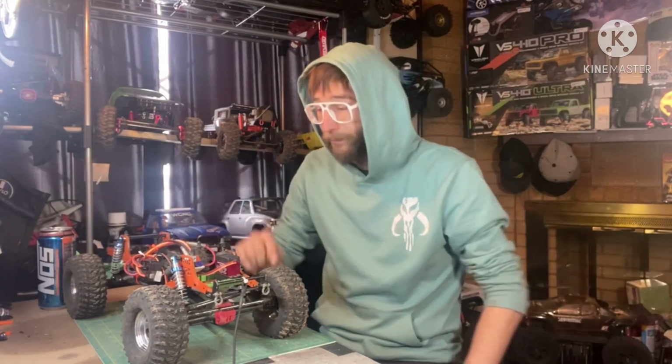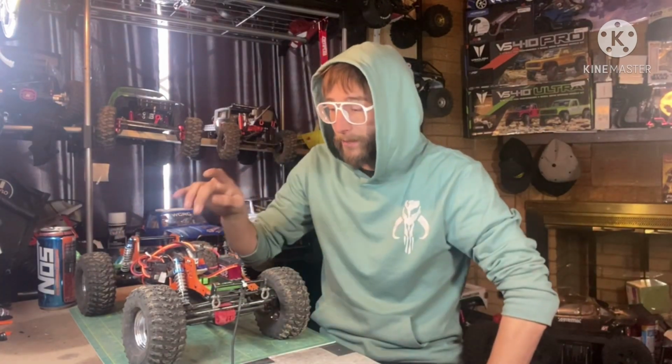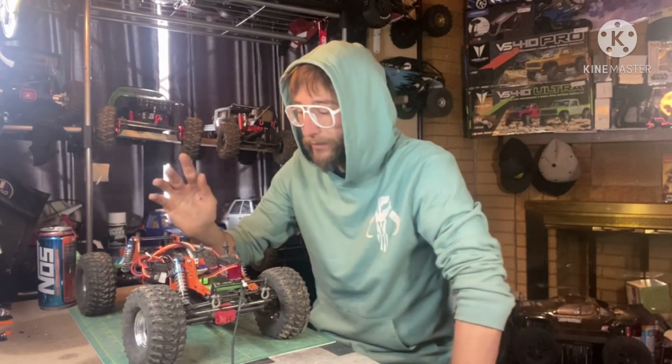Team Garage Hack Tulo, we took my Stealth X transmission and put it in his rig. The Stealth X transmission is also a very good budget transmission to start with, because the Stealth X comes, out of the box, with the optional 6% and 12% overdrives. Since that came out, Hot Racing and I know Team K&K have come out with optional transmission gears to increase that overdrive percentage even more, to roughly 24 to 25% overdrive. So inside of here, we have the Hot Racing UD2 gears.